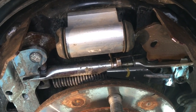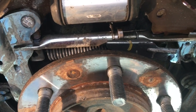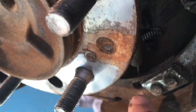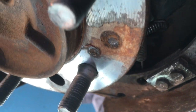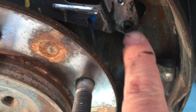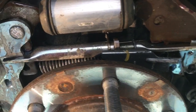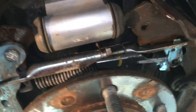Back off your adjustment to make things easier. The main thing: don't let anyone pump the brake pedal while the shoes are off. Then remove your big spring up here — once that's removed the shoes sort of just come apart. There's another spring here too; you can unhook it at the bottom. Take note of which way it goes — the spring faces back towards me, hooking in from behind. Take note of the dowel it sits on. Take photos if you need to.